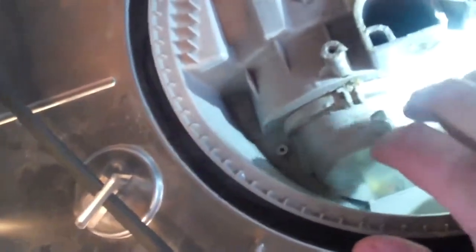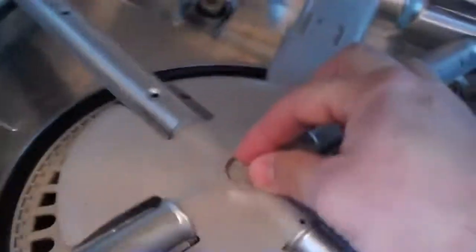There's a segment that you really want to get cleared out — that's the important part. And you'd want to take this one screw out of here, see it there? This is a cover for the part that shreds your food — it's like a garbage disposal piece. Take this cover off.